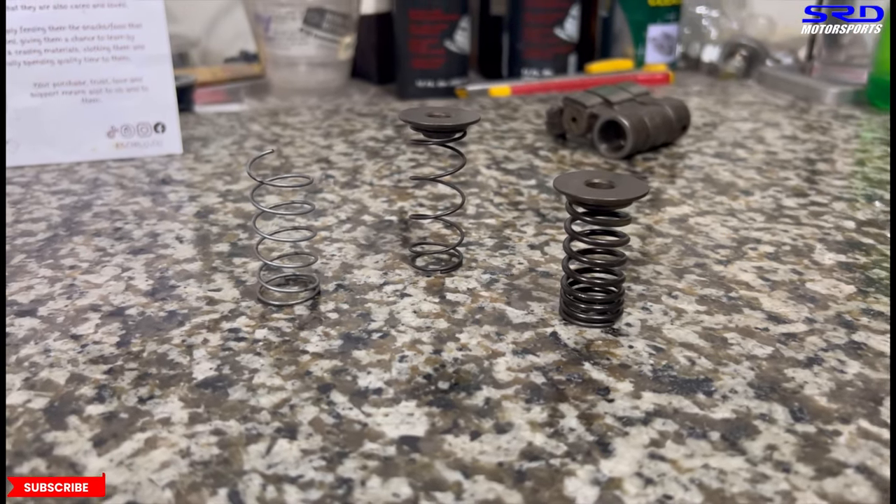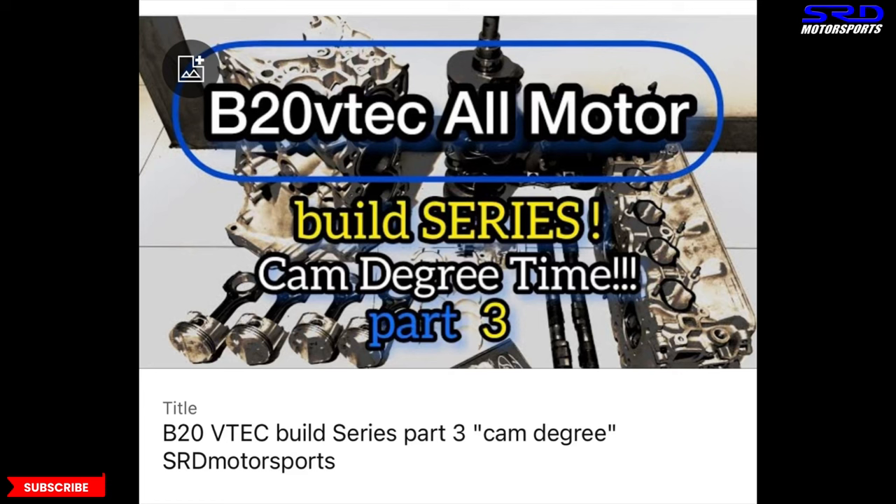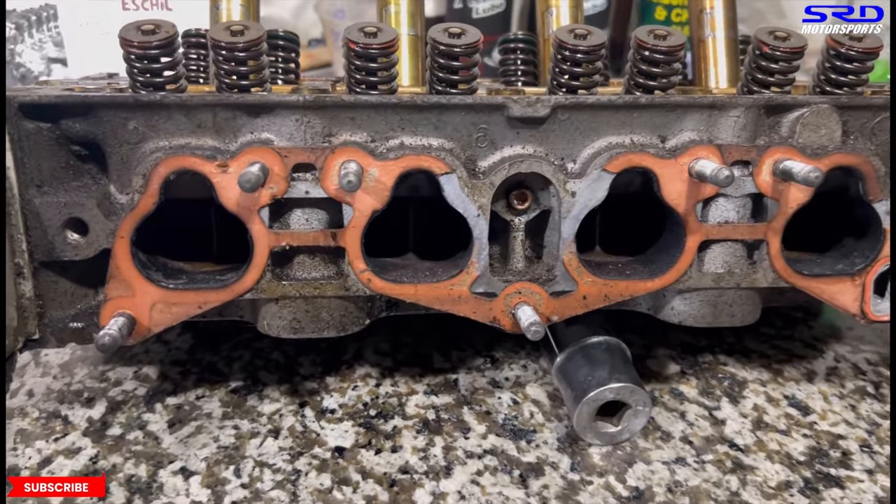The reason you need a softer spring is because if you're on dual springs or aftermarket springs, they turn hard, so you wouldn't know if it's actually hitting or bending the valve. There will be a description link below — we did a video two years ago where we showed how we locked the VTEC and inserted it on the head with the rocker shaft. Check that out if you want.